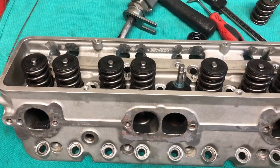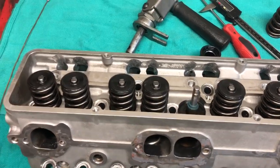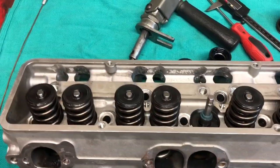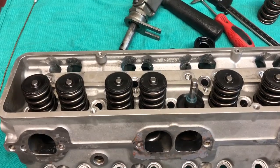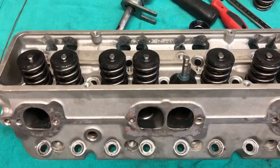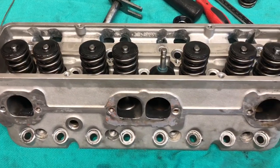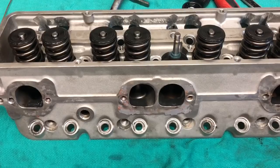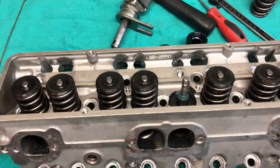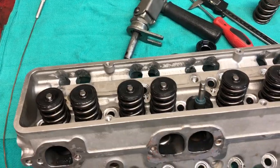You don't want it to coil bind, because if you coil bind the spring you're going to break valve train parts — rocker arms, push rods — something's got to give. With coil bind at 1.15 and my camshaft just barely over 700 lift, you do the math: 1.15 plus 0.700 gives you 1.85. I like to run them a little tight — 50 to 60 thousandths before coil bind — and that's how I got to 1.90–1.91. In that range I've got about 50 to 60 thousandths before it coil binds.